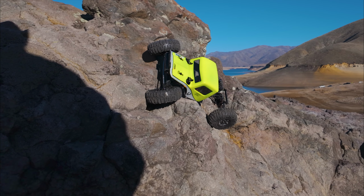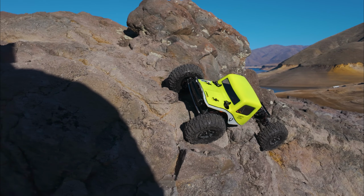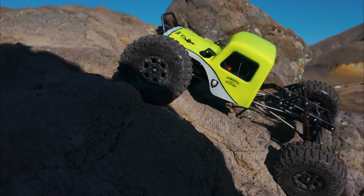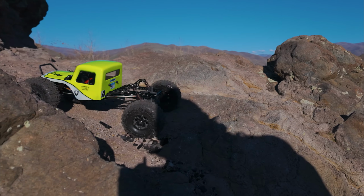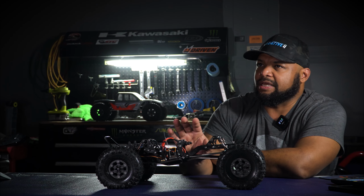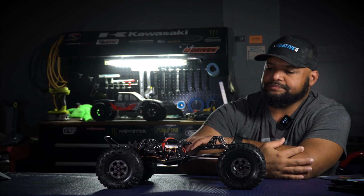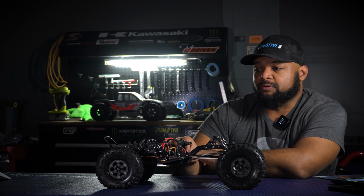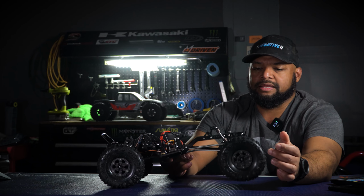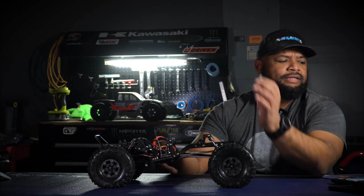And some of that has to do with, again, the geometry, the forward skid, and it's actually a little bit lighter too. So when I first built this, it was 4.4 pounds. Usually my builds are somewhere between 4.6 and 4.8 for the TC or the CC. So when I built this and found out it was 4.4 pounds, I actually added brass to the axles. And that's running the negative G Block Party wheels. I forgot how much these weigh off the top of my head. Let's look.